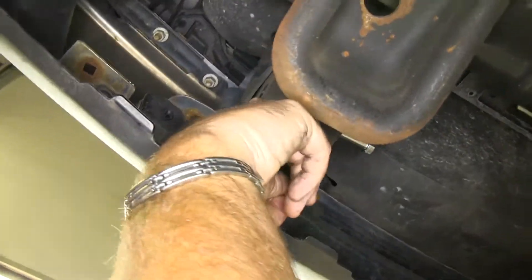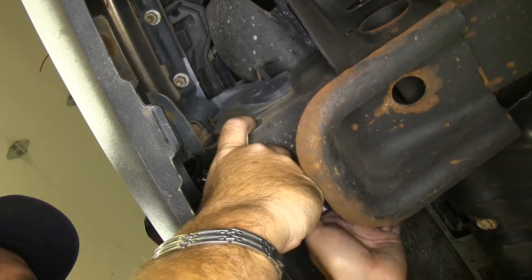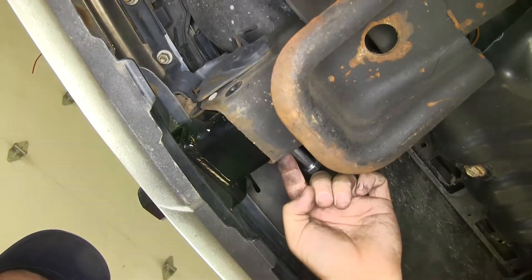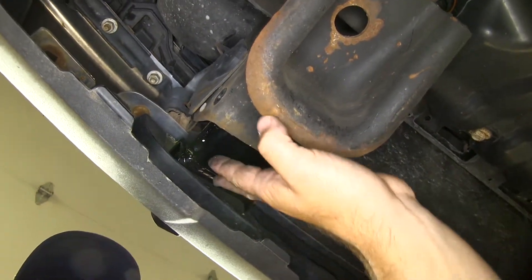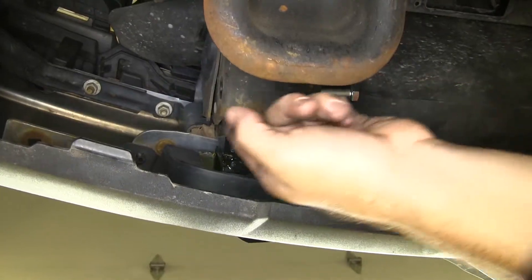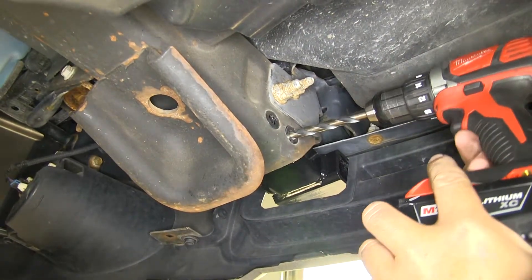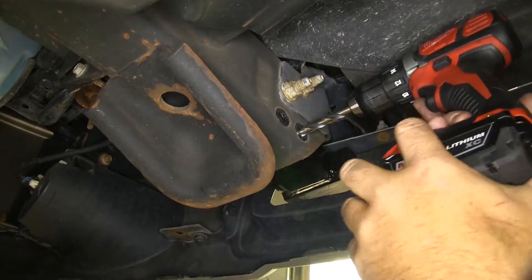As you can see on our front hole, the bolt is not wanting to come through all the way. So what we're going to have to do is take a drill bit and, while this bracket is in place, run the drill bit through to open this hole up a little bit bigger. For this front hole, we're going to use a 9/16 drill bit — it fits right inside the existing holes inside the bracket. All we want to do is open up the other side.